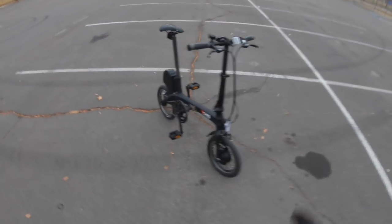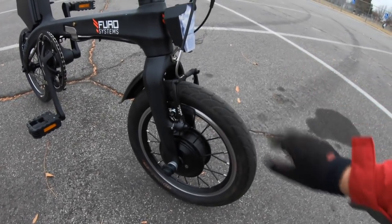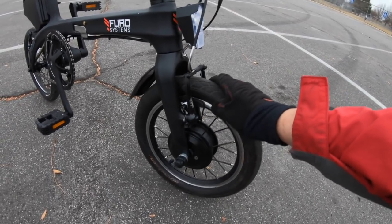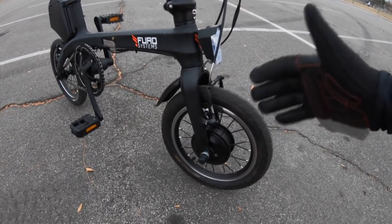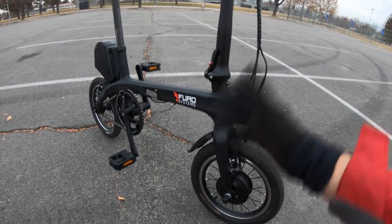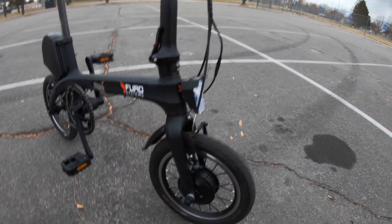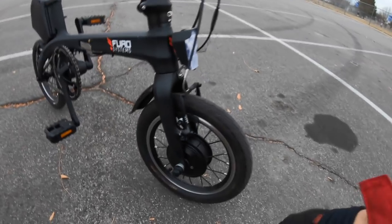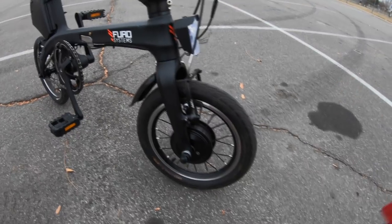The bike is pretty simple, and that's how they keep the weight down. What you've got right down here is a set of cantilever brakes — just some regular pad brakes that you're more or less familiar with from bikes of the past. Not terribly common on electric bikes, because generally you want a nice set of disc brakes since they are heavy bicycles and they go fast. In this case, the bike is electronically speed limited — I believe it's capped at 25 kilometers per hour on this European setting. That's actually a good thing for these brakes. Combined with the lightweight bicycle, you can actually get away with rim brakes. It still stops pretty well because you're not going fast on a heavy bicycle.